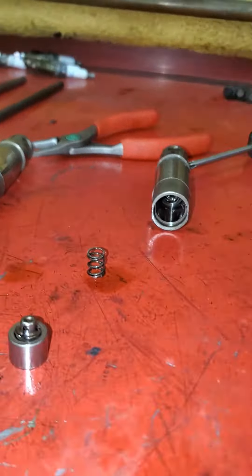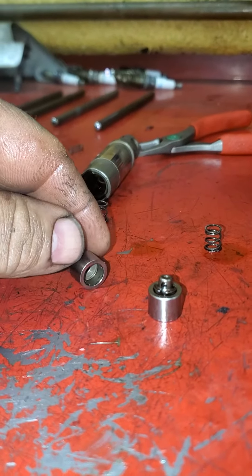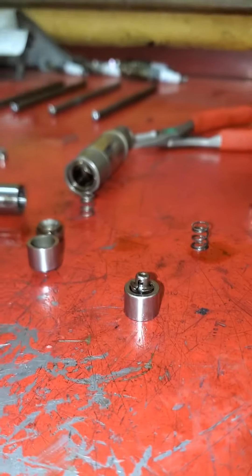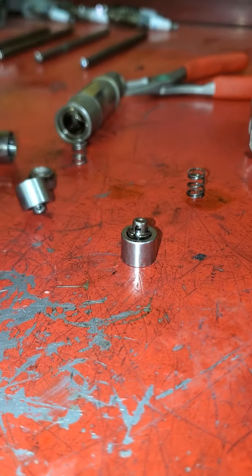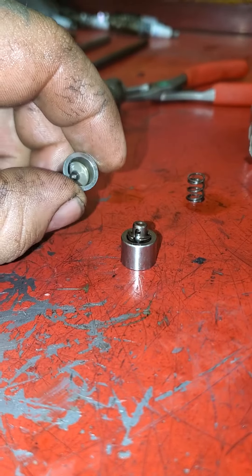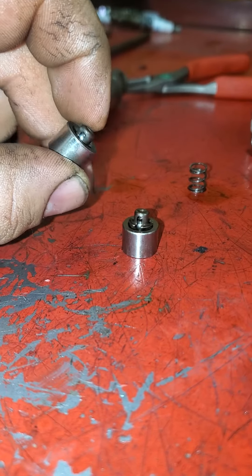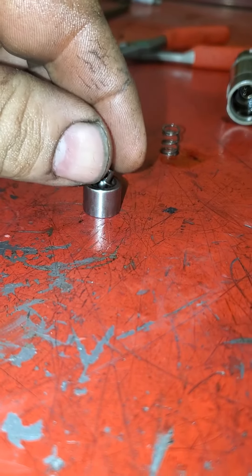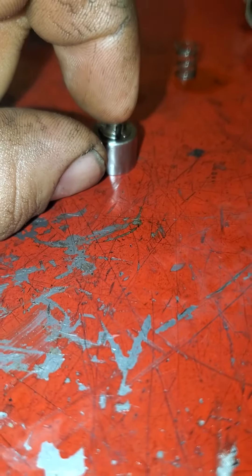So as I was pulling these lifters apart, this is the hydraulic side of the lifter. Now you can see — it may be hard to see — but there is a little check valve in there. The whole pressure underneath is the hydraulic end. Now when I took the bad one apart, the cage — I guess you could call it — with the spring and the check valve, was not attached to this piece.